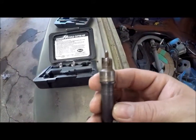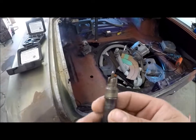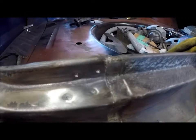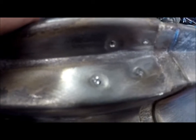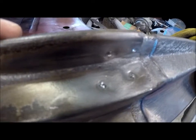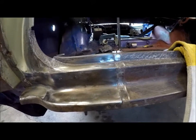This one here is the only one I've used so far - I haven't gone through one. I drilled that whole side off plus the trunk floor, wheel wells, everything. I'm going to keep using this one; it's starting to get a bit worn but I'll go until it doesn't work. I just brushed them off with a wire brush and you can see the divot where the spot weld holds on. I center punched it and drilled a small hole for this pin to sit in - it just locates it better, and then this little annular cutter cuts that out.